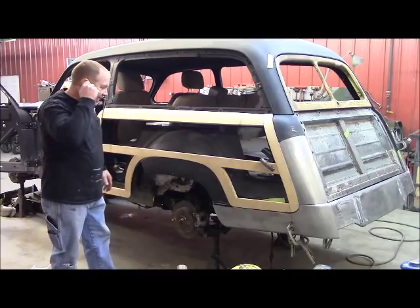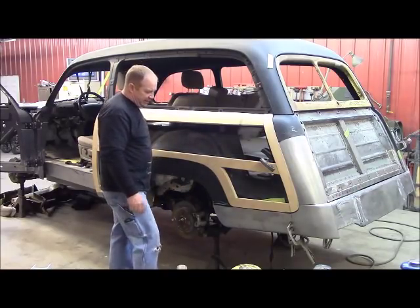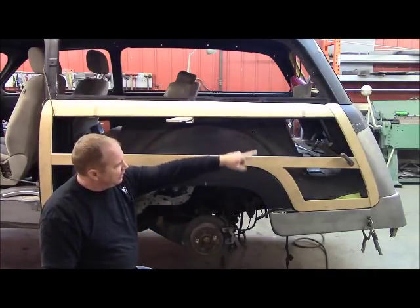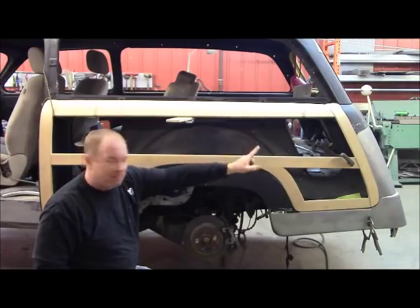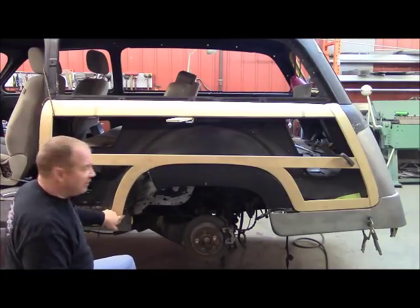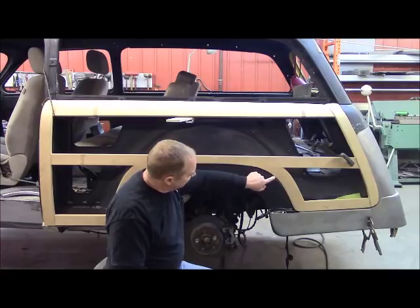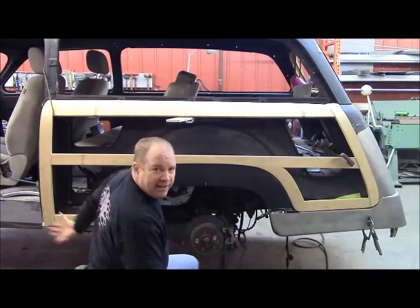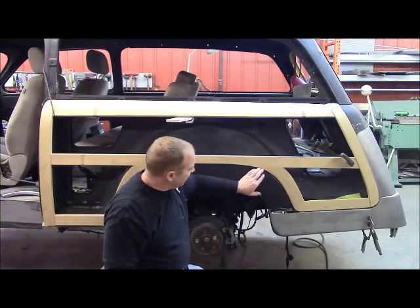In a perfect world with a good body all together, I could just fit this wood in this pocket and go on with it. But I just don't have any of that. One more thing about setting all this wood up - there are so many factors involved. I had to come in here and measure all the wood widths. Your back post down through there is about two and a half inches, your front post is about two and five eighths, this post right here is about two and a half, and this one right here was about two and three quarters. When I found that one, that's going to help me a lot because I'll be able to take that little quarter inch off all the way down through here, which is going to give me clearance. That's the only place I was tied at, and that's going to save me from moving the front and moving that whole piece - because I really like that piece right where it is.